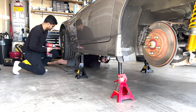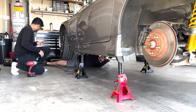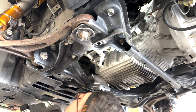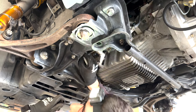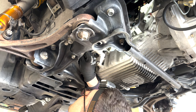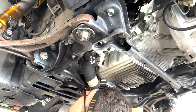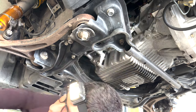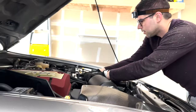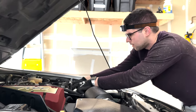First off you're gonna want to jack up the car on a nice flat surface. Trying to do this on any type of slope will make it much more difficult. Next you're gonna remove the wheels to get easier access to the front subframe bolts. Considering that we'll be dropping the front subframe about an inch or so, we'll begin by marking the position of the steering rack with a marker and then disconnecting it from the steering rack coupler. Then depending on your intake setup it's a good idea to disconnect your intake from the manifold. Dropping the subframe an inch or so also means that your engine will drop the same distance and you want to avoid causing unnecessary stress or damage on the steering and intake components.